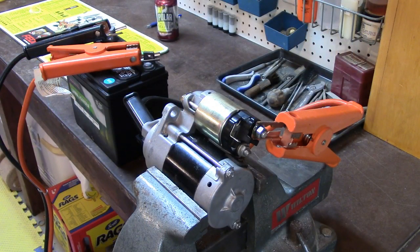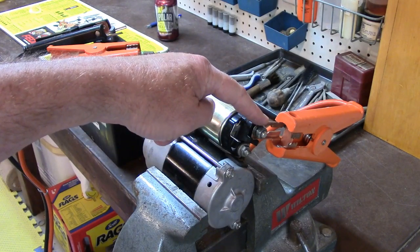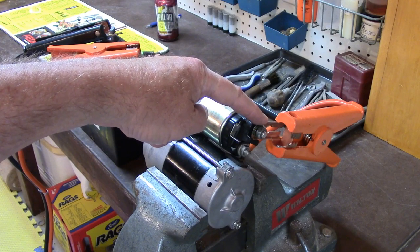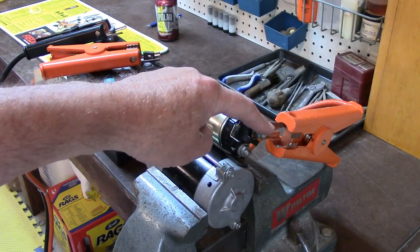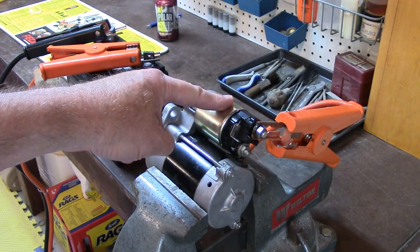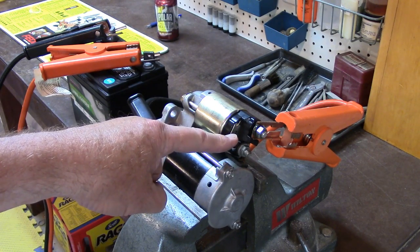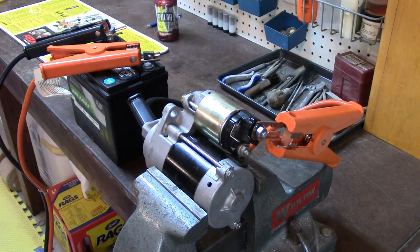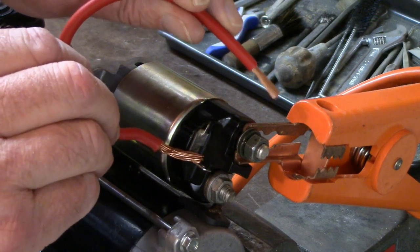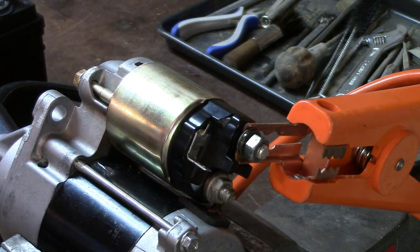Okay, so we've got it all connected. The battery is hooked up — the negative is connected to the chassis of the motor, and the positive is connected just as it would be from your positive battery terminal. The goal is to make sure the solenoid is making electrical contact between this pole and this pole via a mechanical disc actuated by an electromagnetic field, which is energized by your ignition switch. By jumping this to this with a jumper wire, it should start this motor up. So we're pretending we're turning the ignition switch — and we've got a functioning starter. The solenoid is connecting properly and it's turning that motor over.